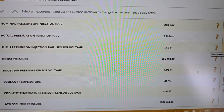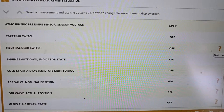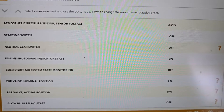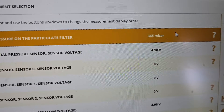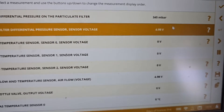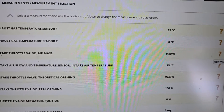I'm trying to find atmospheric pressure - here's the particle filter ash and soot load. Here are the EGR values: exhaust gas differential pressure. This value is not the best - if you see it at around 0.3 bar when you're working, that's actually a pretty big pressure in the system. That means your DPF filter is going to be full.